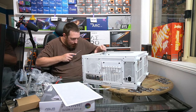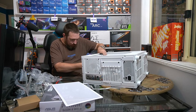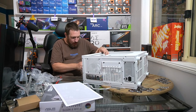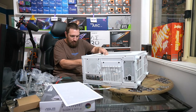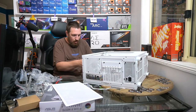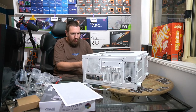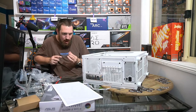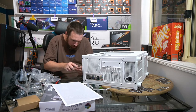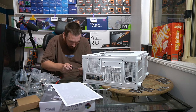So when you're mounting a radiator, you'll normally have four bolts per fan. Now, if you're trying to position it and you end up covering up some of those bolts, don't freak out too much. In general, as long as you've got like four to six bolts, it's going to be fine. If the metal covers the others when you've got it in the position that you want, don't be like, oh no, I can't mount it like this. It's got to be like 2 centimeters further that way, because even though it looks like shit now, I've got to screw in all those screws.